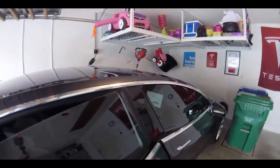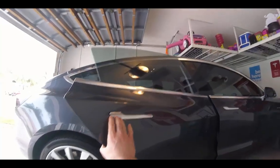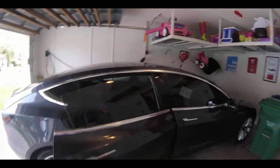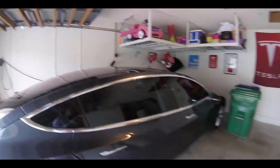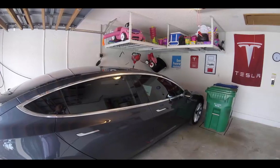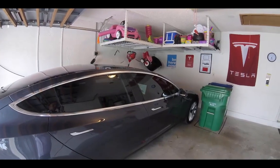How do we fix that? Press the door handle — the window drops down those two inches — and then they can go ahead and close the door. Just a quick public service announcement; I hope this helps and I hope none of you end up with a scratched piece of trim around your windows. Good luck everyone!